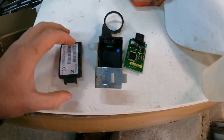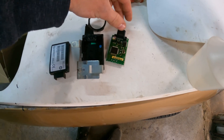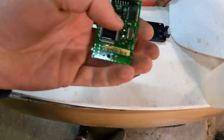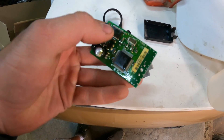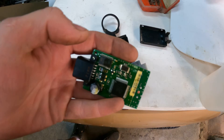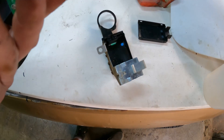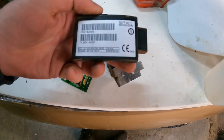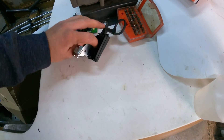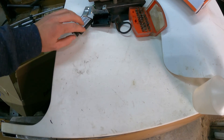Off camera I tried to see if I can bypass the immobilizer on the KJ. This is your SKIM unit — sentry key immobilizer module. I took it apart to see what's going on inside and if I can bypass some of these pins. But because it's got this chipset, you can't bypass it. This is the little frequency from your key; it works on a certain hertz. Right here it's noted — this one is 134 kilohertz.